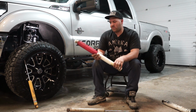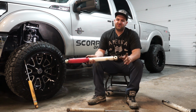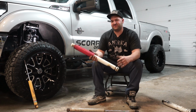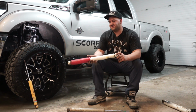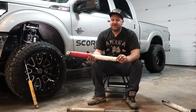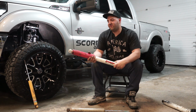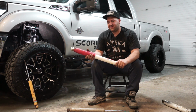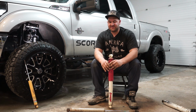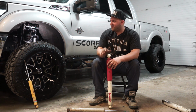Cost: like I said, when it comes to lift kits, usually the base shock is a hydraulic style shock because they're the cheapest to produce. The next step up would usually be a nitrogen charged shock, which performs better because it doesn't fade or aerate the fluid, so the dampening characteristics stay consistent. They're a little more expensive because they're more expensive to produce, since there's hydraulic fluid and a nitrogen gas charge inside the shock.